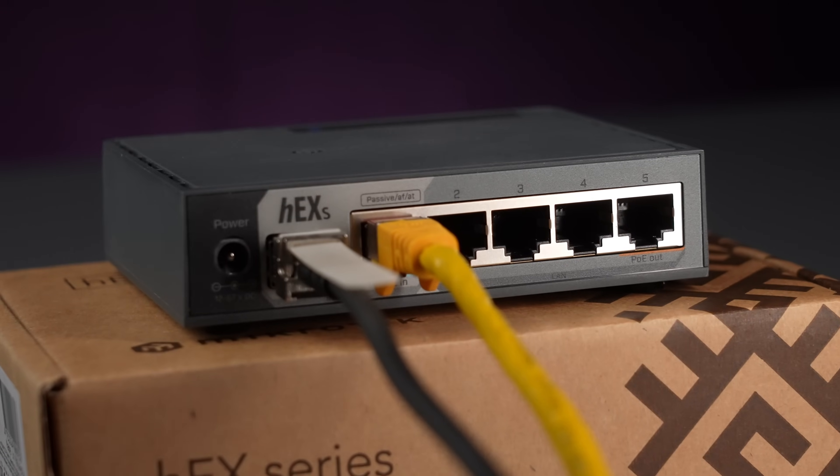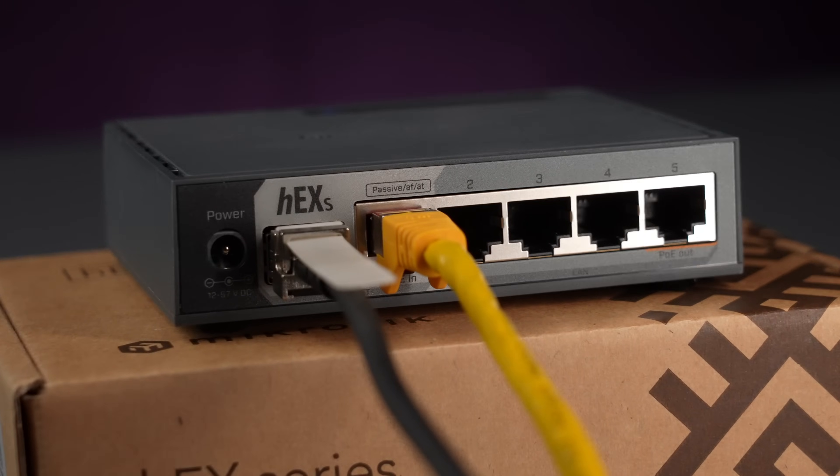You can watch our tutorial on that here, but the idea is pretty simple. I would connect my gaming or content creation PC to the HEX-S using the 2.5Gb SFP port, then bond the 2 Gigabit Ethernet ports to my NAS server so I can move huge files without hitting the Gigabit ceiling. It is the perfect internal backbone for creators, gamers, or anyone with a lot of local data to move around.